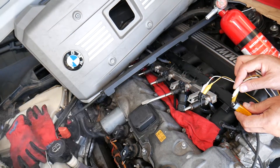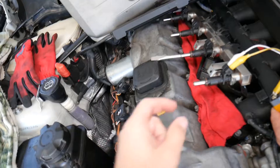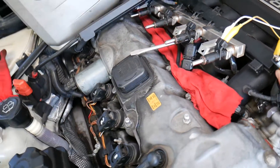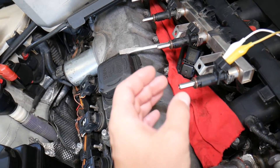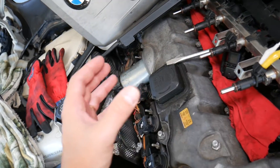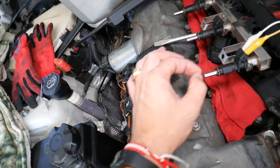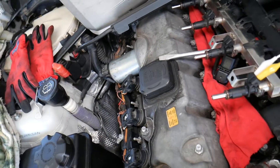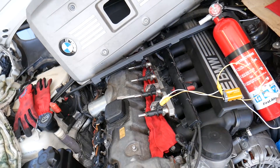Check it out — the fuel injector is spraying really, really good. That's definitely a good spraying fuel injector. Make sure it also closes fast, because it could be dripping fuel. The spray pattern should look foggish toward the end. If it's kind of leaking and making a string, it's not good — it needs to be foggy looking. This is a good working fuel injector.